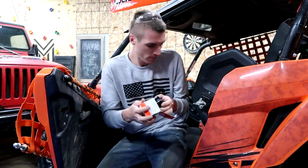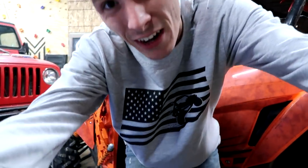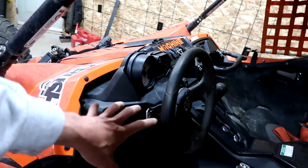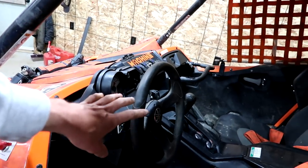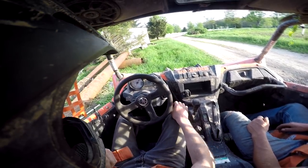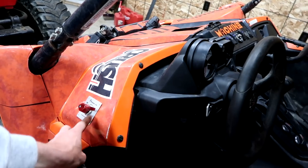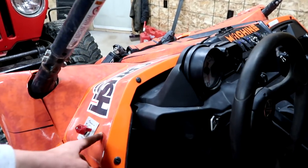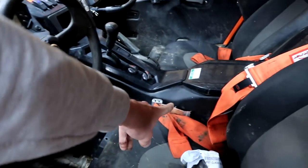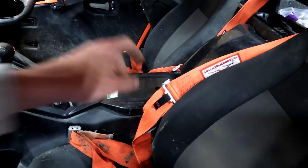I bought two oil filters. I don't know what that oil changing process is going to be now that I have a skid plate on. You need a skid plate when you race because you need that extra protection. I also bought some more heavy duty wire for the kill switch, because if you guys have paid attention in the last couple videos, you've heard that Crush doesn't turn over as fast. I think it has something to do with this cable — this is the only variable that changed — so I'm going to replace it. The wire has to go up over the dash, through by the transmission tunnel, over into the battery. So we took out the seat for the thousandth time and now we're going to have to take it off for the thousand and one time.